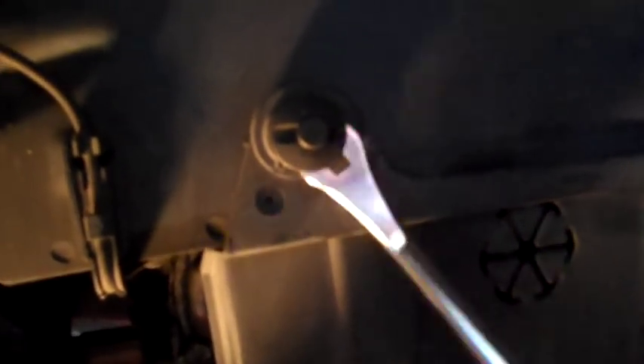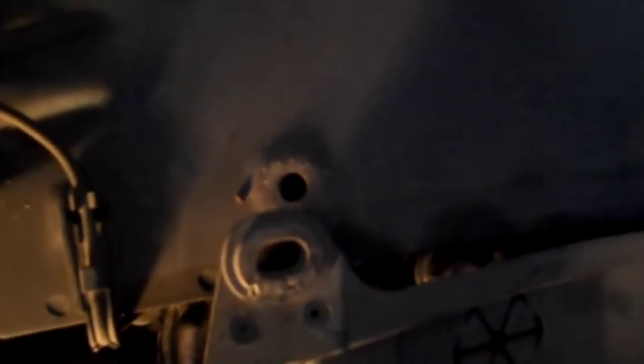I've already attempted to remove that belt tensioner bolt one time using a wrench and I could not — it was just on there super tight. So this time I'm going to attempt to gain access to it. I think if I drop the motor down just a little bit I can access it just barely, because this wall ends right here and then comes to an L. I can just barely get an extension in that way and hit it with the impact wrench. I've actually already bought a new bolt at Honda — they're only about $3.50 for that tensioner bolt — so if I happen to break it, I've got another on hand.